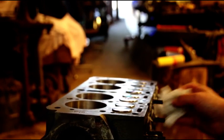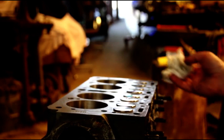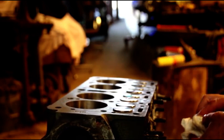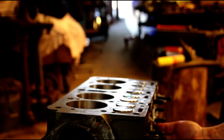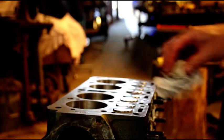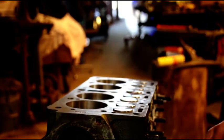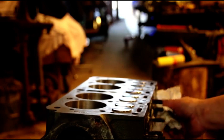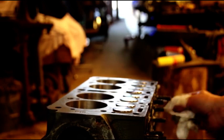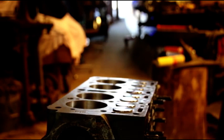There's no tricks. There's nothing going on. This is just good machine work. Proper 3 angle valve job. And like I always say, when the valves are jumping like that, you know you got a good 3 angle valve job there. Just a shorty — just want to show Gary what he's getting. Everything passed the vacuum test, and we will continue on with the rebuild. See you on the next video.